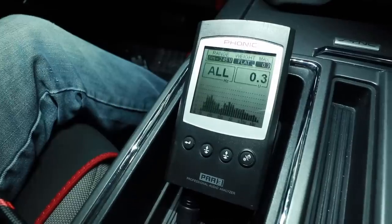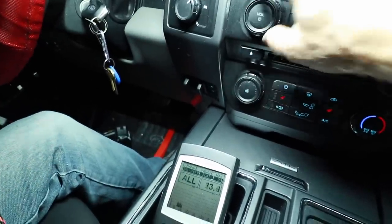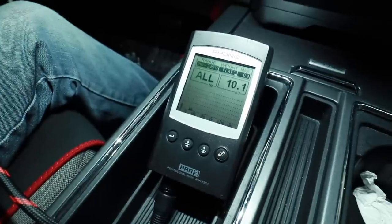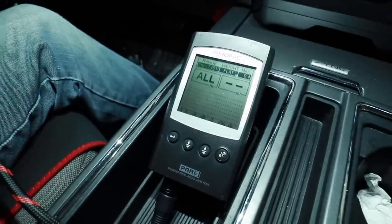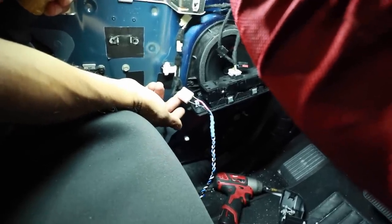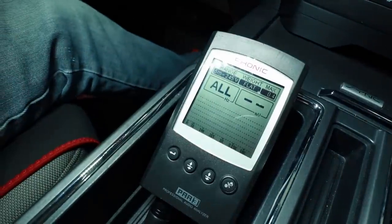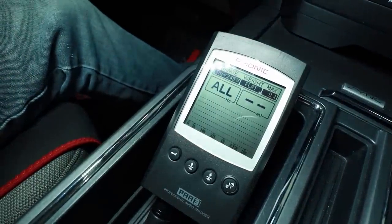Here's what it looks like when music is playing — you can see we're getting movement, and even one or two clicks on the volume knob gives us movement. We don't want any, so make sure the volume is turned all the way down. We've pulled the door panel off and connected to this front speaker here. Most of the time it's going to be either the front speaker or the subwoofer that you want to test. Go ahead and rev up the engine. As we guessed, this truck doesn't have the fake growl — that makes us happy.